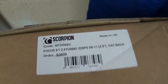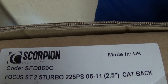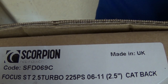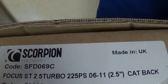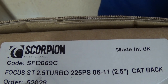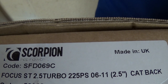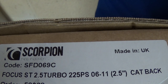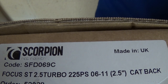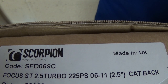So as I've mentioned, we've gone for a Scorpion cat-back 2.5 inch. You can get a three inch exhaust but that means we'd have to change the cat, which we don't really want to do at this time. I think eventually we'll probably have a three inch downpipe, decat it and stuff like that, but for now we want something that looks nice, easy to fit, good quality with a bit of a look. The criteria also included not too noisy because this thing is a track day car.